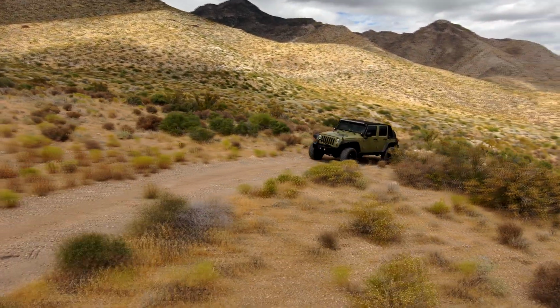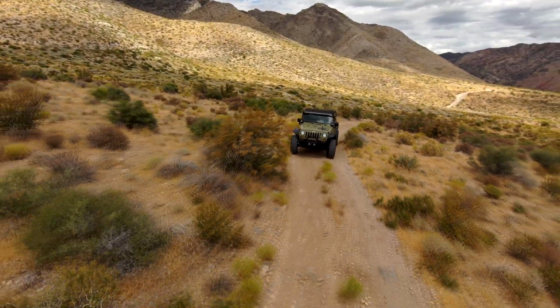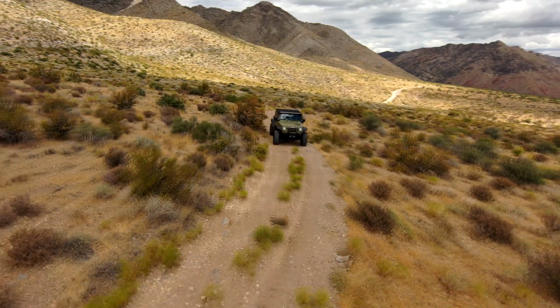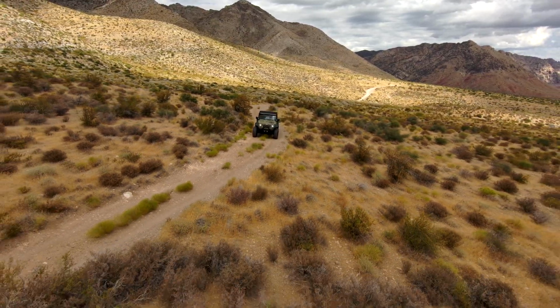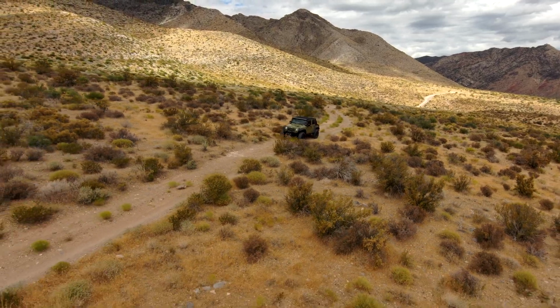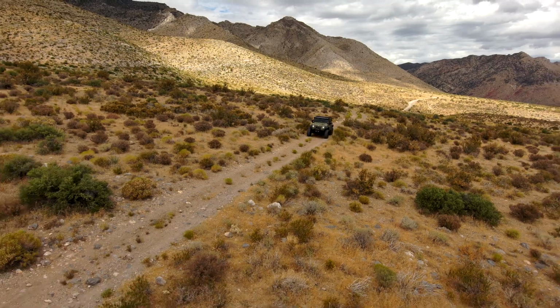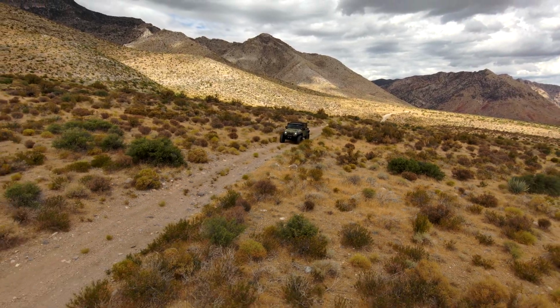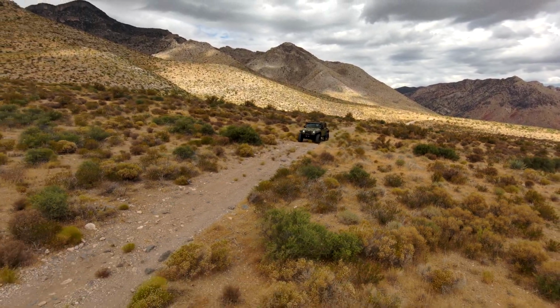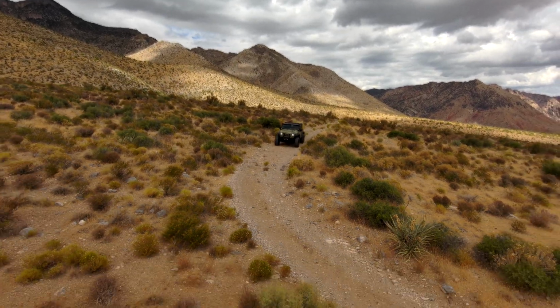So what they do is, at about 185, the JK gauge goes up to about half, or just before half. And it kind of stays there until about 225, 230. I don't like that because it's not linear. You don't really have a warning. It goes from 180, 190, 200, 210, 220, and then all of a sudden it just shoots off of half gauge and you overheat. If it was linear and you could see that precise movement, it would be better, because then you could react faster.